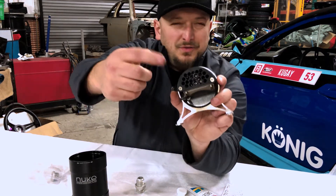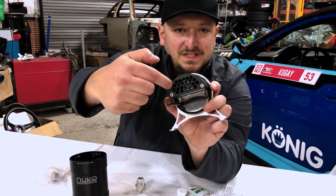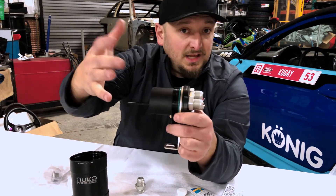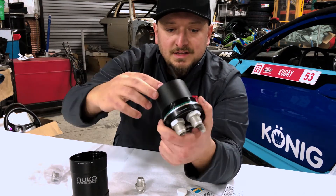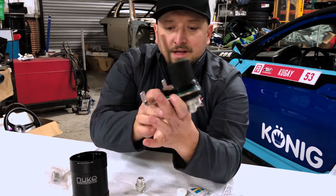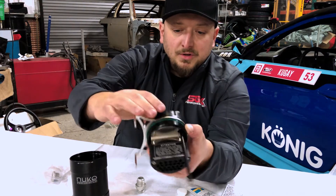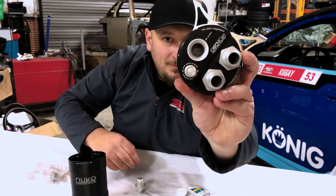On this competition one, there's essentially steel wool inside. There's steel wool that you can clean — the two Allen keys right here, you can pull those off and then you can clean this section inside. Pretty trick. The second filtration comes on the outlet where there's a baffle, but then you'll also see there's a screen right on the inside there.